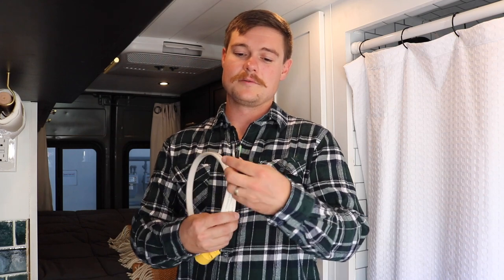If you have two load wires running next to each other, then it's both of those combined that you're worried about heat-wise. So make sure you size your wires according to whether they're running through conduit or running through insulation or just hanging out in the open air. If they're just running through a cabinet, then it's less to worry about. You also need to keep in mind if they're bundled together as well.